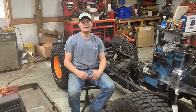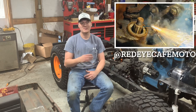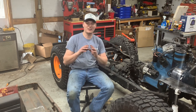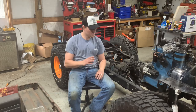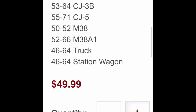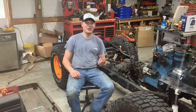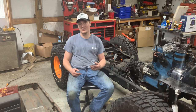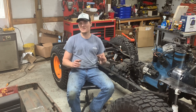There is a double-lip seal option - you can also change the seal inside the transfer case. I chose not to do that because it's a brand new seal since I just rebuilt the transfer case. I'll have links to that seal and everything else used in this video in the description. I do want to say I'm not sure this is the most cost-effective route. If you hop on Kaiser Willys' website, they've got these yokes brand new for about $50. These ready sleeves usually run $30 to $35 - I got lucky and found one on Amazon Warehouse for $15. So it seems like you could just spend $50 and get a brand new yoke rather than messing with the sleeve. Unless you're doing a restoration and want to keep it all original, in which case this sleeve is a great option to fix up your old yoke.